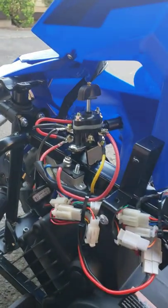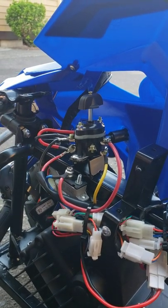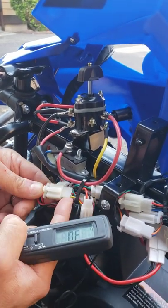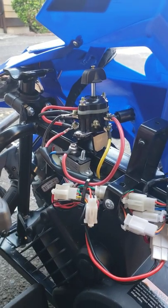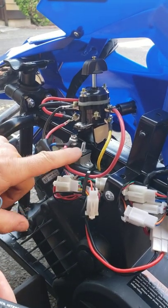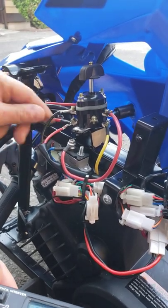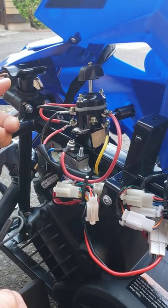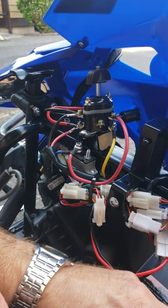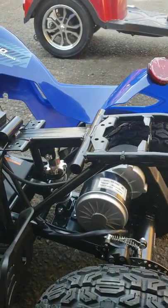This is how you know which part you need to change — either the switch or the relay — if your machine is clicking. In my previous video I showed you it could be as simple as a loose wire somewhere, like on the throttle handle, so check for that please. And the very last possible problem: if everything is passing power, you overrided the overheating relay, tested the switch, all wires are tight, the controller is clicking but it's not going, then you can suspect the controller, or in a worst-case scenario, the motor itself — which is really, really rare, because if the motor fails, you would see smoke coming out from that motor.